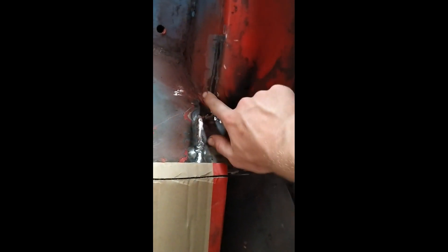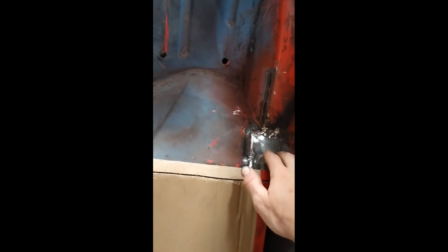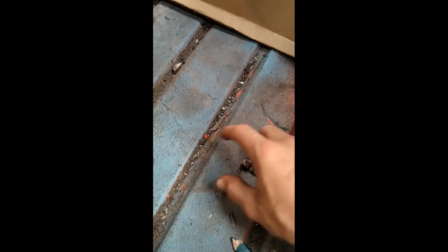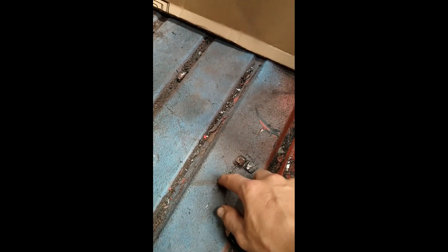So removing the companion box gives you more room to weld. I also took the flanges off and the wheel arch here. I decided to just get rid of it and patch it up. I probably should have made a butt weld patch — cutting the hole and making the replacement metal the exact same size — but this is a rally car and I want to make it a quick project. So I've just put a patch on it. The welding isn't great because I didn't sand back enough paint in the corner, and there's some rubber sealant from the factory. I used one millimeter mild steel, cut it to size, and welded it with the MIG welder.